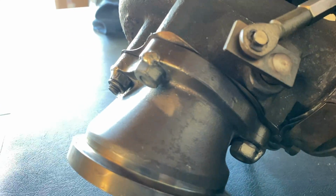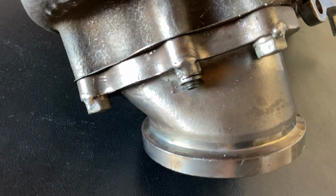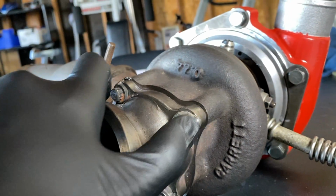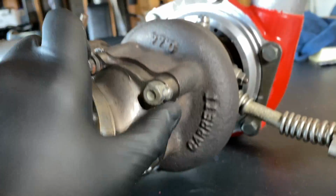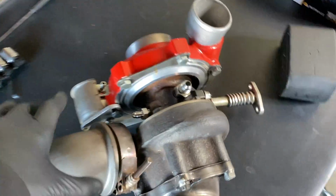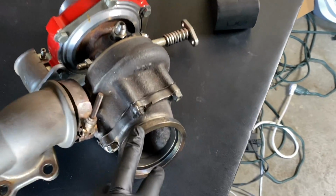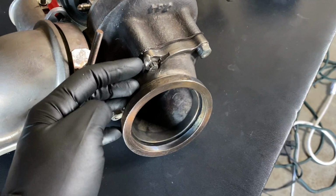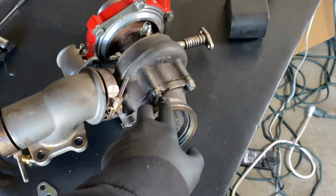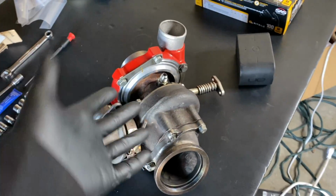And now I can show you guys what we did here. All finalized. So all 5 of the bolt and 1 nut locations, all of them have been welded. So there shouldn't be any way that this housing should come off anymore. If you have this kit, I know they come with updated versions that have these wedge lock washers, which make it really hard for the bolts to back out. But still, this is going to be a problem regarding your big turbo ATP kit.